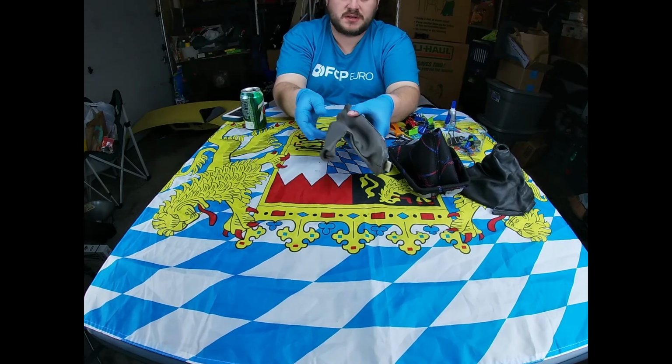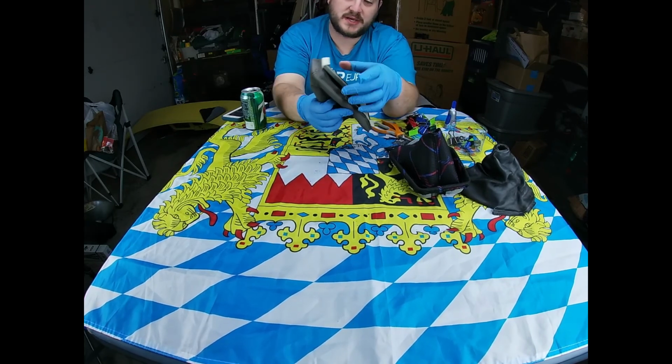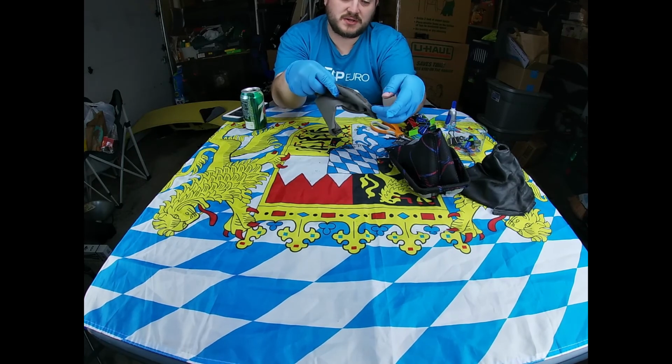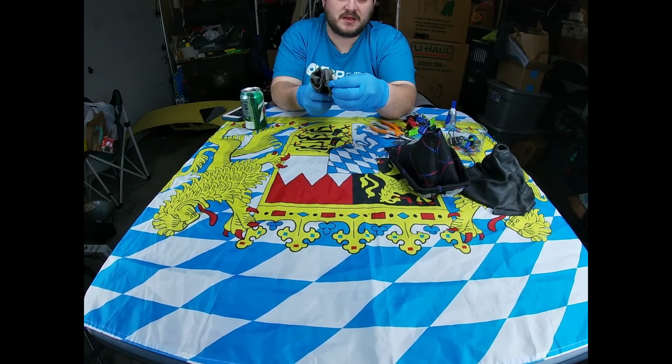And for the rears, it's basically identical. You'll take the leather off again, or the old vinyl. You'll start with the edges, glue down the sides, leave the corners undone. You'll do the edge about 1 inch on top, 1 inch on bottom, depending on what kind of e-brake you have. And then you'll come back and put your thumb on the inside again and hold your fingers down around the outside to do the corners.